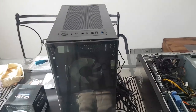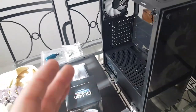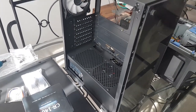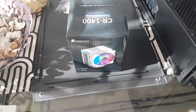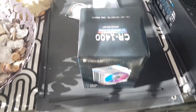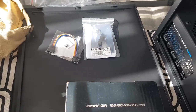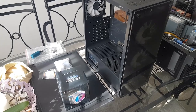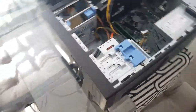We don't need anything flash for this — it's a workhorse. I wanted the facility for additional cooling and the ability to put a bigger power supply in to support the 3060 Ti and just to clean things up a bit. Other things I bought: a new ARGB cooler to go on the CPU, and the normal modification cables and front IO port boards, very similar to what I did on the Dell OptiPlex conversion, which should hopefully make this go swimmingly.